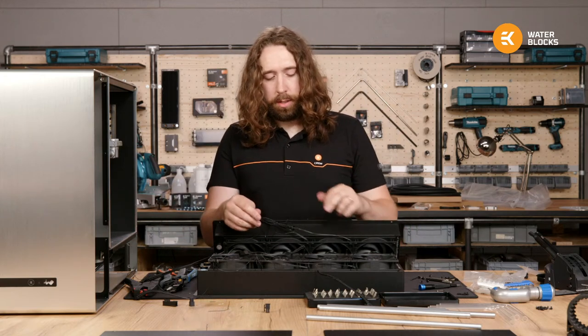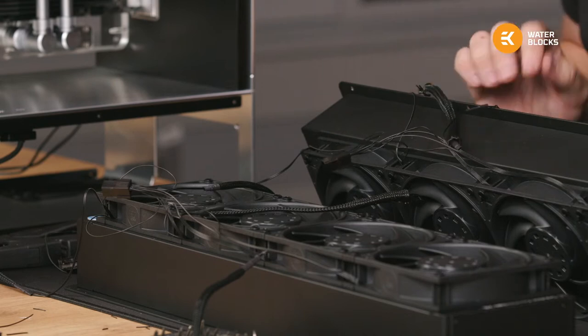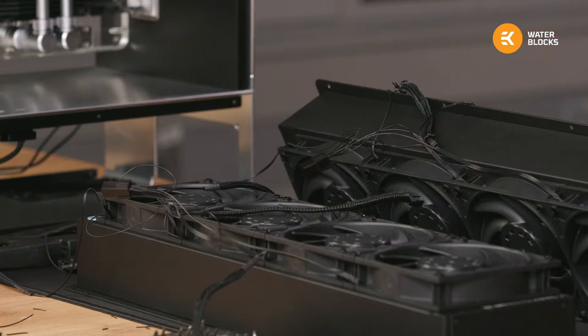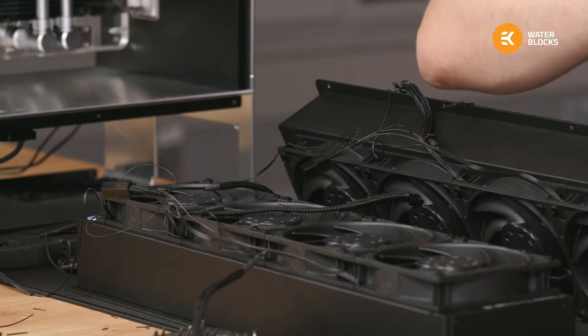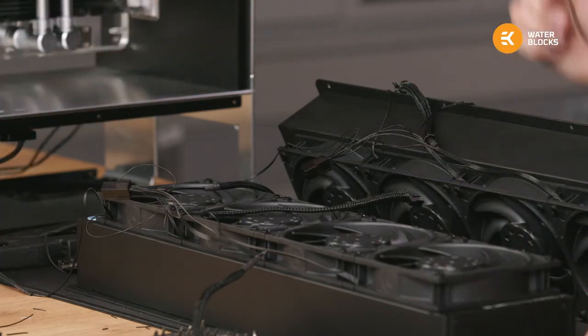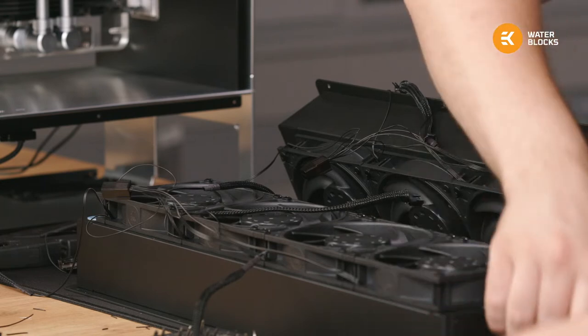Okay, so we now have the ground and the voltage for each fan wired into these little blocks. So I will take the power supply and I need to quickly make 2 ATX extensions to join them up. I think I'll just make a test one with no sleeving for right now. So these are the usual female ATX crimps. And then I'm gonna need the 4-pin connectors and a 6-pin from the power supply, which is over here. And 2 wires.